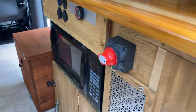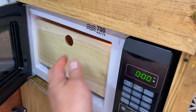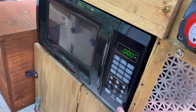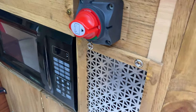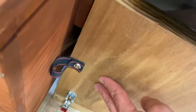That red switch is the disconnect for the inverter — it's a 2,000-watt inverter for the microwave. Inside the microwave I have a tray to hold various things and store items when not cooking. The 2,000-watt inverter is a Harbor Freight Tools inverter — not the greatest but it works. All the electronics are behind this silver grill: a 100 amp-hour lithium iron phosphate battery that I custom built, the 2,000-watt inverter, fuses, switches, and charge controller — all in that tiny compartment between the microwave and the cubby on the right. There's also a smaller cubby underneath the microwave with a nice latch.